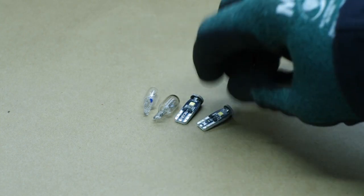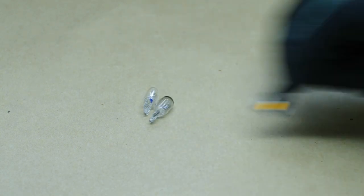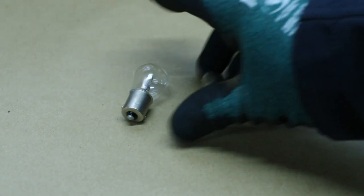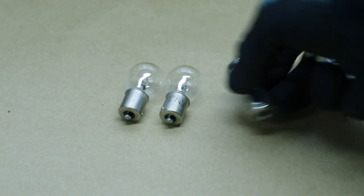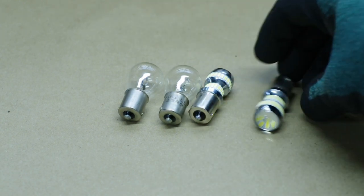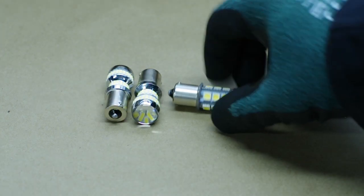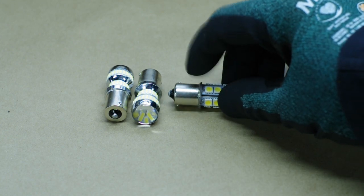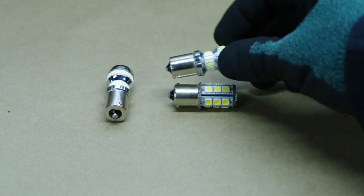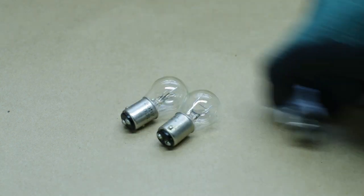194s come in a wide variety — some are CAN bus enabled and some are not; more on that later. The backup lights are 1156 bulbs, and they only have one circuit, so most options should work. What you do want to avoid are bulbs with large overhanging lips, as they will probably not seat all the way in the socket. The turn signal and brake lights for the back are 1157 bulbs.